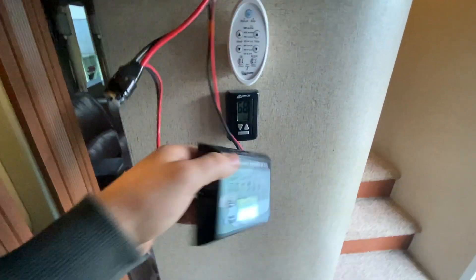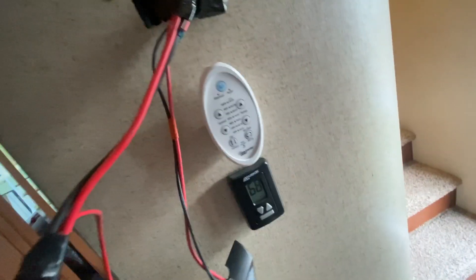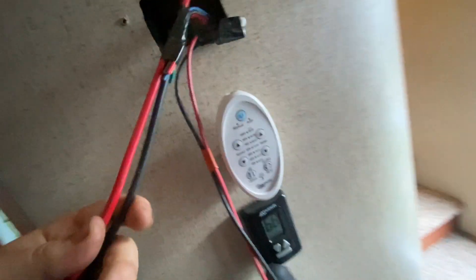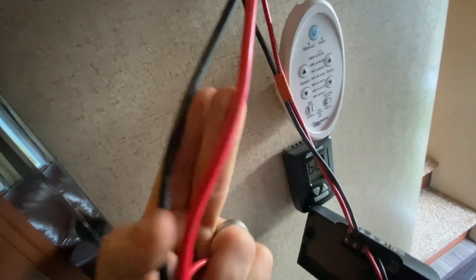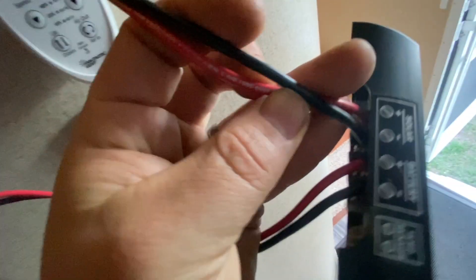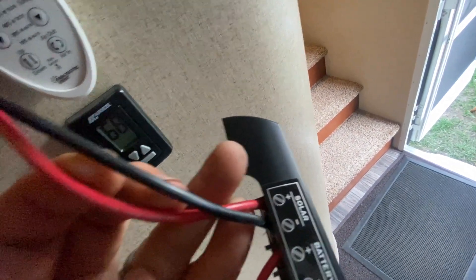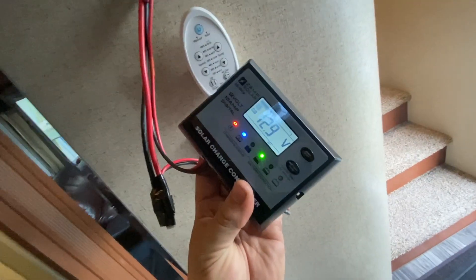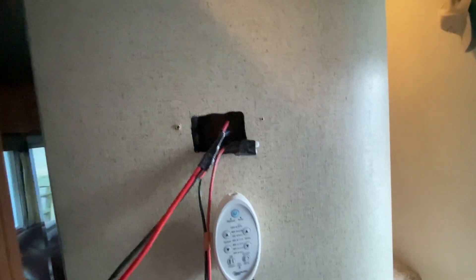Pulled this out — this is the charge controller, and that little panel got the voltage up to 12.9. Not bad. As far as I can tell, these are the battery connections all the way up here, which means you could put a pretty beefy controller right here if you wanted to. These are the existing solar connections, but they're not big enough — this is probably 12 gauge, not 10. So if we wanted to keep that controller, we'd have to keep it here. And there's also a Cerbo display here — we'll get to that in a minute.